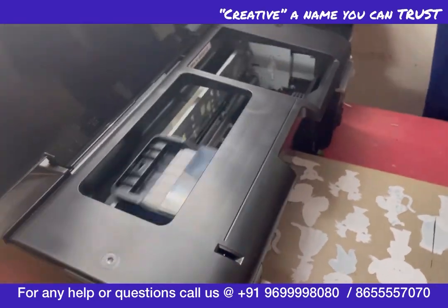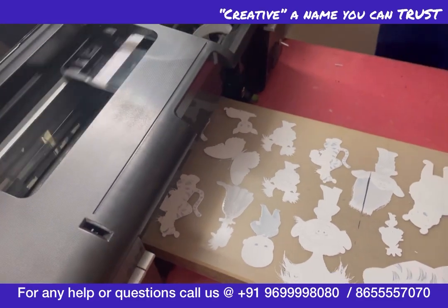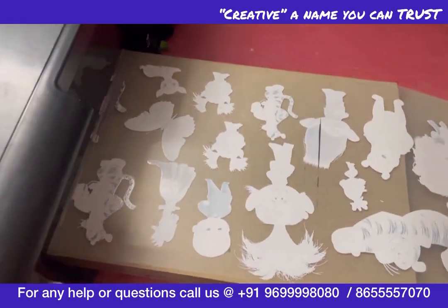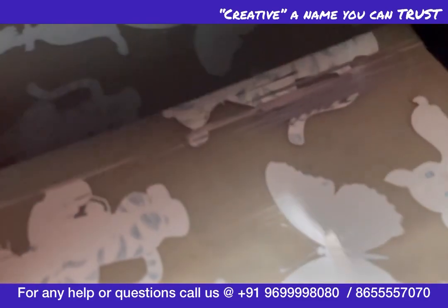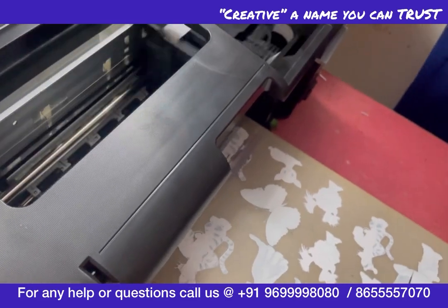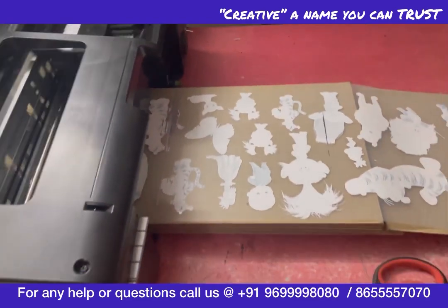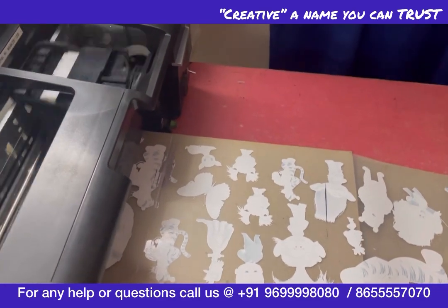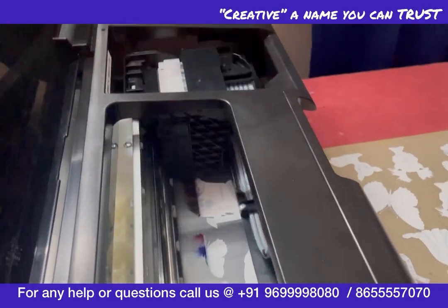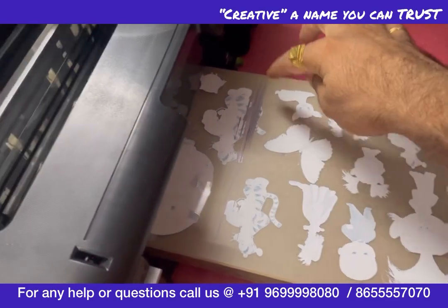In a normal 805 or 1800, you may see scratches on prints. The paper is hitting the print head — that is the reason a spot or line appears on the print. When I tried to take the paper, that line became visible. Your platform has to be flat, at least two feet after the machine. Most people ask me why this line appears — that is exactly the reason.